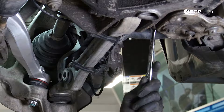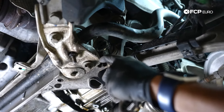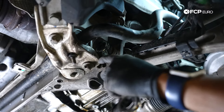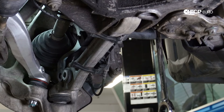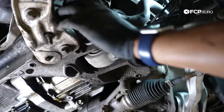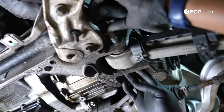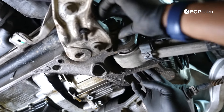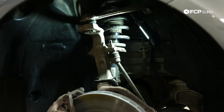Same as the other arm — got a nut and a large washer. Now I'm just sliding this bolt out of this cavity. We are going to need to drop the sway bar just a little bit to get clearance for the bolt for our lower control arm. This is a 19-millimeter nut and I'm counter holding with a 9-millimeter wrench.